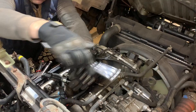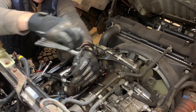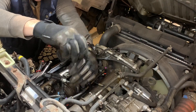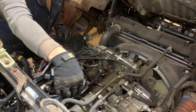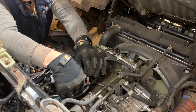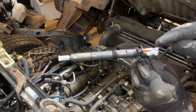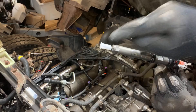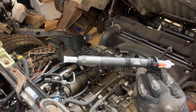I've taken these injectors out a gajillion times, so everything in here comes apart nicely for me. If you have not pulled your injectors out, don't expect results like this — your injector will not come out like that. Once you get the injector out, make sure you keep the supply, the return, and the tip covered. Don't touch any of that. You don't want to get any dirt in any of those spots.